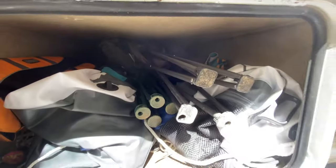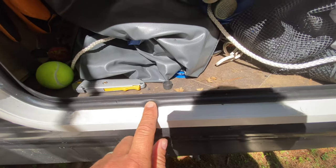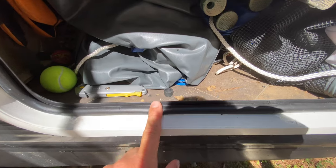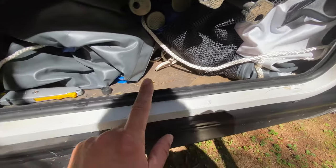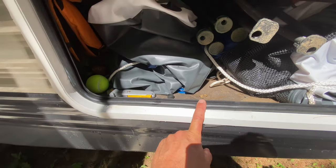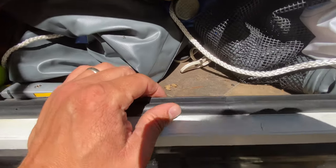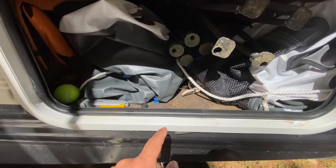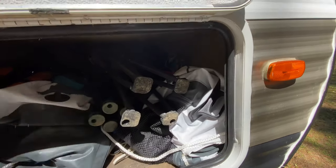The water was coming between the gasket — which you don't want — and dripping down inside. I have a half-inch lip at the bottom right here, and there was an automotive-type seal on here from the Heartland factory. I bought the replacement seal at O'Reilly's in the auto body section — it's a half inch and has a 3M backing on it, so it's self-sticking adhesive.